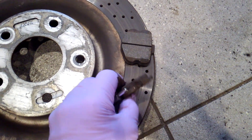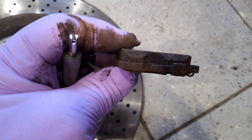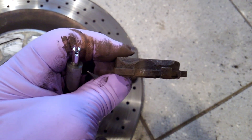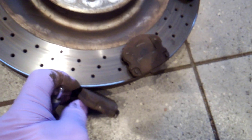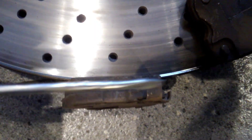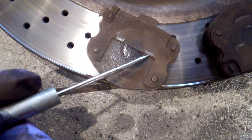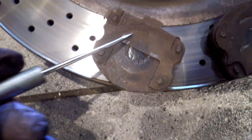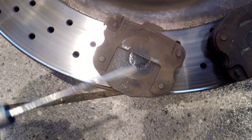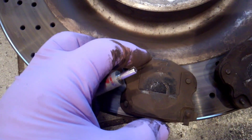There's also more to it. If you look at the actual wear, you could see that it's actually tilted. What do I mean by tilted? If you look at the wear of the actual brake pad, there's more thickness here than there is over here. That's because of the way the shim is — see the heavy contact here? That shim creates a little bit more brake pad contact. When you angle the brake pad, it gives you slightly a little bit more contact.